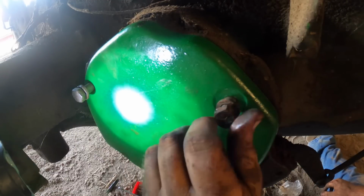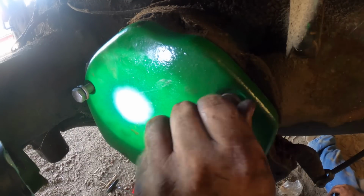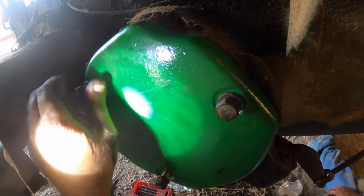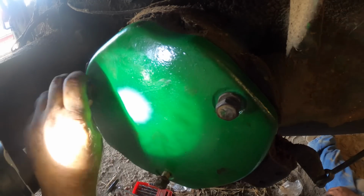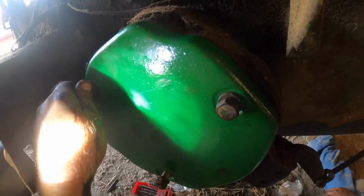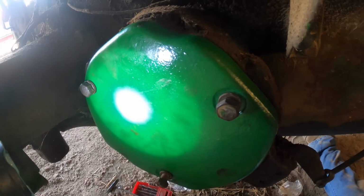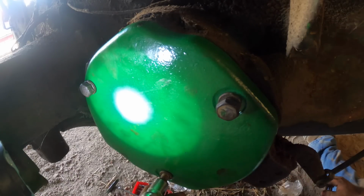Oh yeah, I think that'll be adequate on this one. I've had to do more before if they weren't very worn, like your housings, castings, but this one was pretty worn. I ran it through the old Fiat flywheel resurfacing tool and that took a bunch. It had a pretty aggressive lip worn in it, is what the problem was.